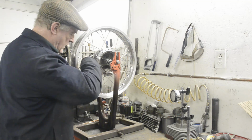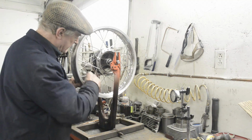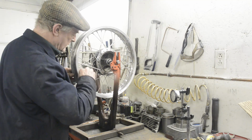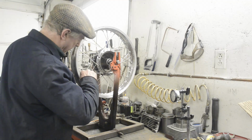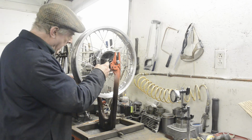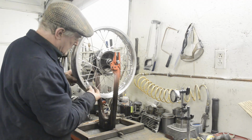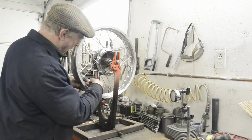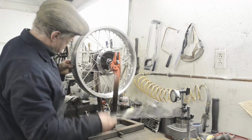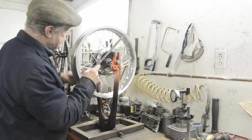What I'm going to do is 3 spokes, basically one at the point I'm measuring and one either side. And you can see this one here, now I've started to move it, I can actually tighten that one up a bit more with my fingers. So let's try number 4 again. Actually, we came over a fraction too much. So we'll just slacken them off. There's number 4 pretty close.